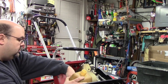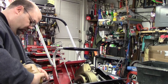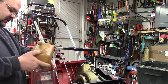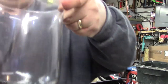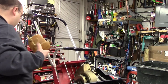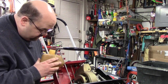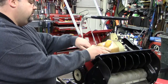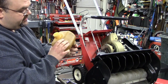Trying to do this without taking that back cover off until I know for sure I need to rebuild or at least clean the carb. I'll try to get this off without spilling too much gas on the floor. I think we're about 50-50 on this if I had to guess. There's a lot more oil showing in there than what I would expect to see. I think we get some fresh oil and gas mixed up for this thing — we might just be surprised here. It smells a little bad, but it ain't too hateful. I don't see anything in that tank other than gas and oil. We got that tank emptied out. We'll get this thing back on here. I really just wanted to pull it off in case it had sediment in the bottom, but there's really nothing in there that I can see.